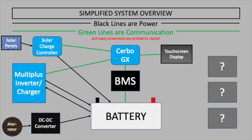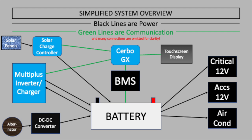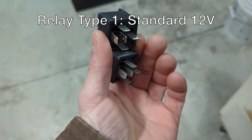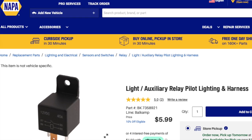And then there are the other discharge sources - essentially any other accessory or component wired in the van. I'm going to group these into three things: critical 12 volt loads, accessory 12 volt loads, and the air conditioner. Before we get any deeper, I have to quickly talk about relays because there are actually three different ways the term 'relay' will be used in this video. First, there's just the traditional little 12 volt automotive relay you can find at most auto parts stores.